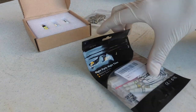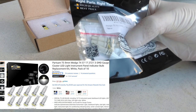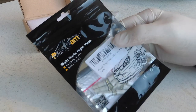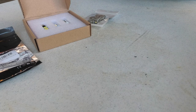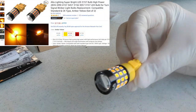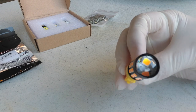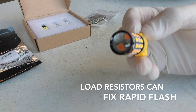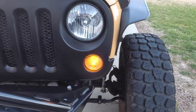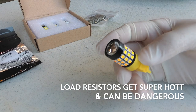These right here are for your front dash — like your speedometer area — or they go in the floor. There are some floor lights we're going to try to get these into, and I'll post these up. The next thing I've already tested is a front blinker LED that can also be used for a rear tail light. I've been testing it in my Jeep — the Southern Comfort — but it does throw a code and goes into a rapid flash. It still works, but it blinks really fast and gives you a ding saying you've got a blinker out. Basically these LEDs are more efficient and the Jeep sends too much power to them, so it doesn't know what to do.